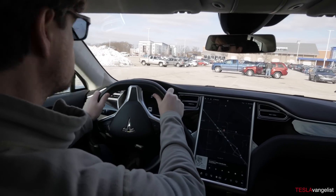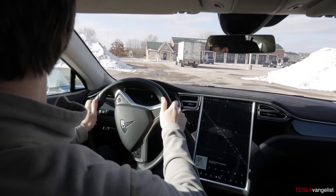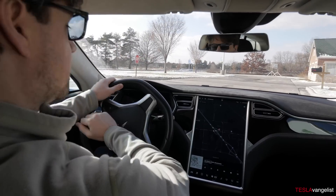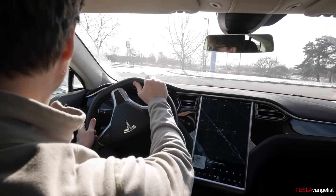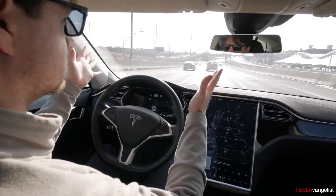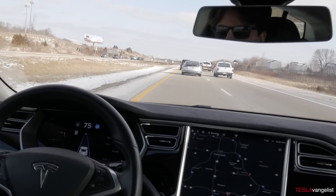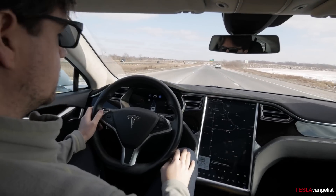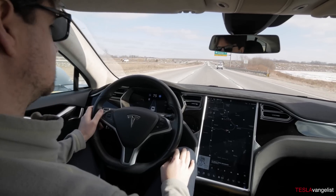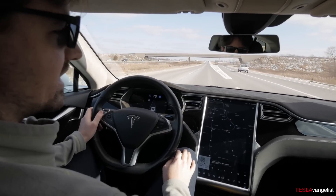Charged up to 60%, which is not quite as high as I was before. Time for leg two. The battery is pretty much completely warm and I'm not changing any of my heat settings or the route or anything, so we'll see how much less energy we use. Definitely using less energy this time — I'm at 404 watt hours per mile and I expect that to go down a little bit. At least it's consistent.